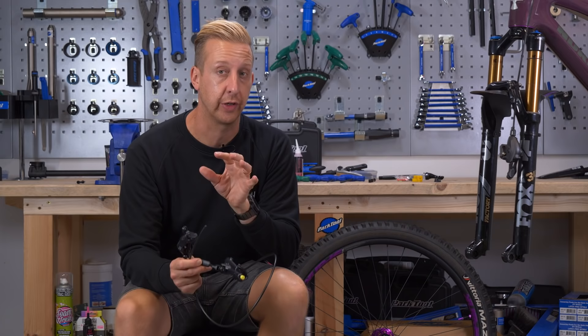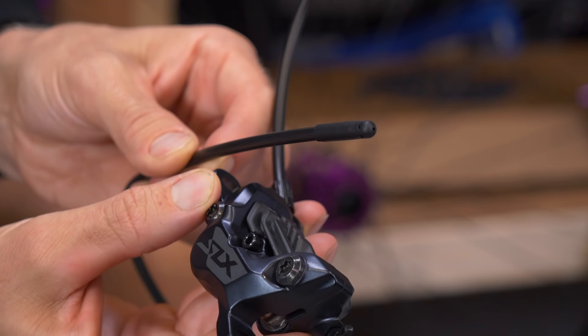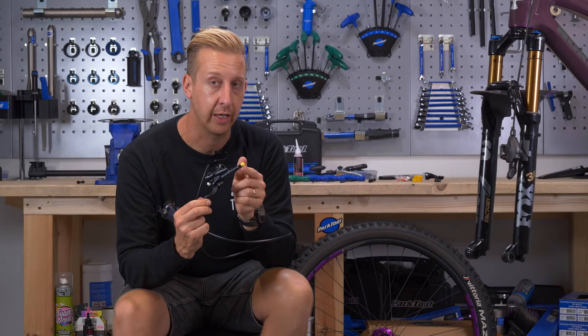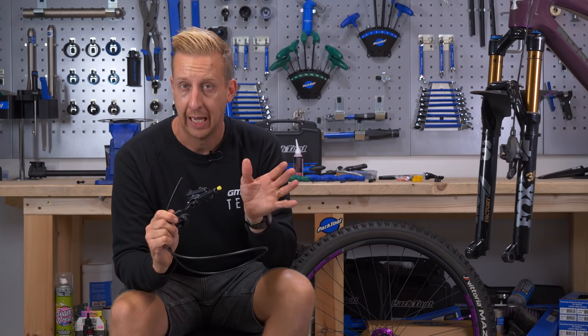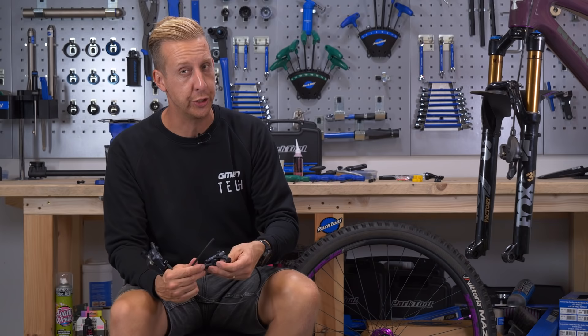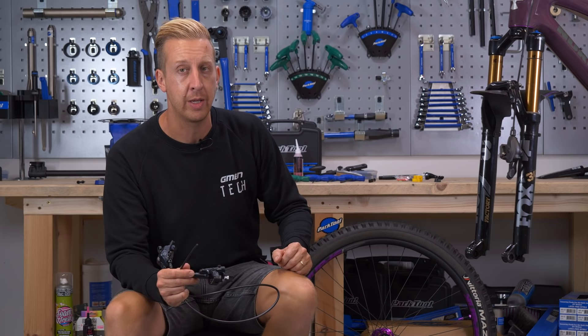Before you get started, make sure you have all the correct parts and that the brakes are going to fit and be compatible with your bike and wheels. This particular set has come with the hose attached to the caliper, prefilled, with a rubber sealed cap over the end. The lever is also prefilled. That means when I trim this down, there should be minimal fluid loss. However, that's not always the case — sometimes you'll need to break that seal and do at least a lever bleed. Other times, the caliper, lever, and hose come as separate entities, meaning you'll definitely need to bleed the system.